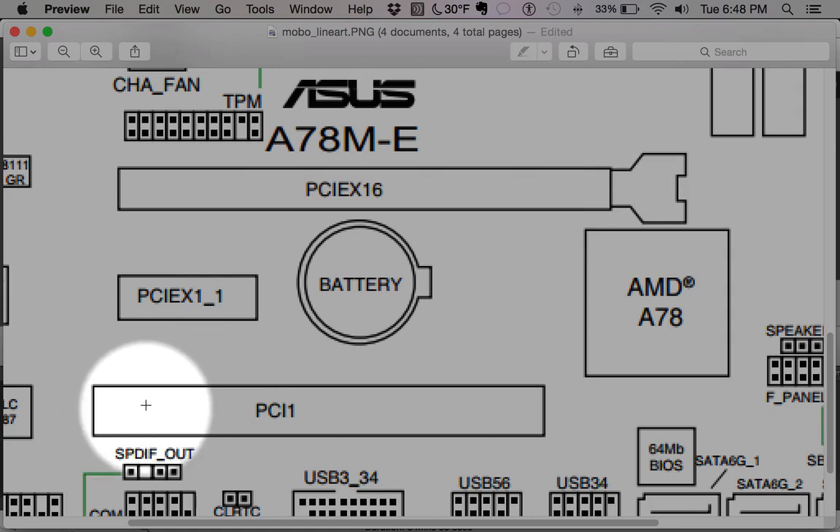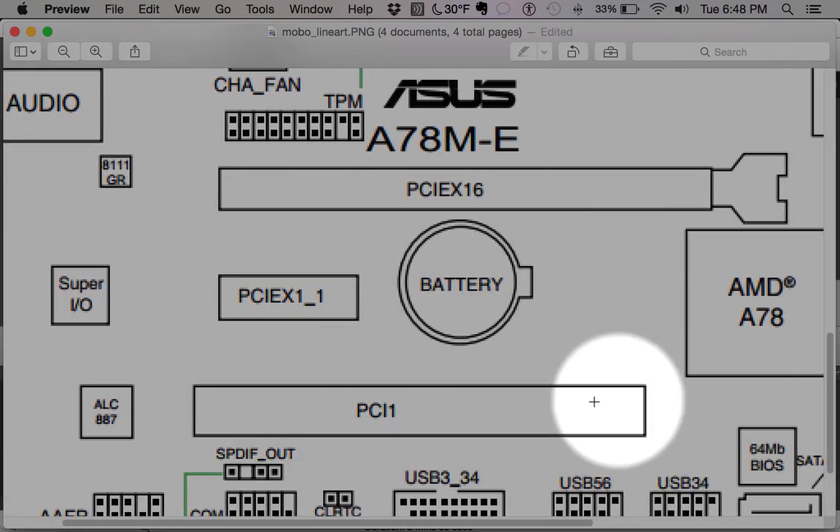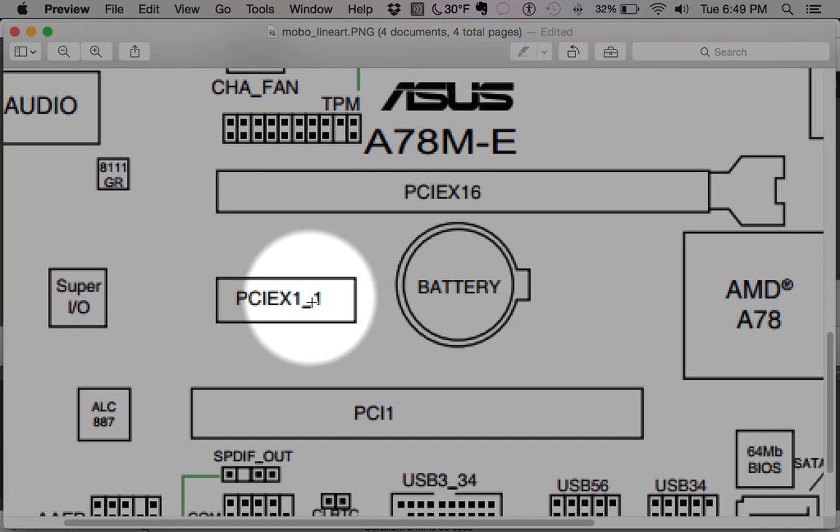These are our PCI slots. This is the old-style PCI, which has been around for a long time — generally used for things like enhanced audio cards or a TV tuner. You don't see PCI slots used very often in home or basic user systems. PCI Express x1 is a more modern type of PCI slot — you'll see things like enhanced audio cards or specialized communication cards in here, but the slot is very small.